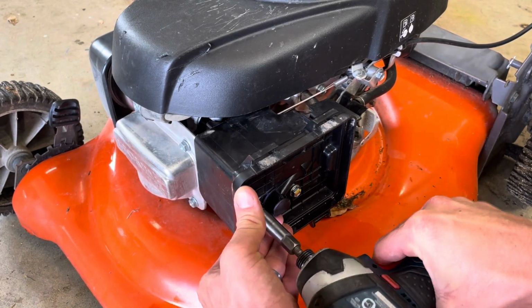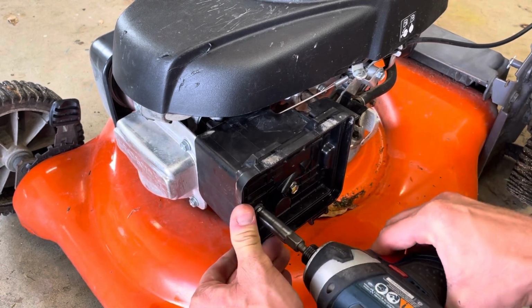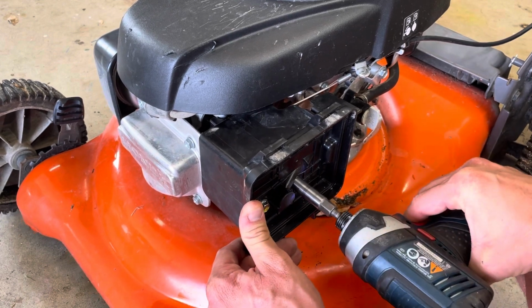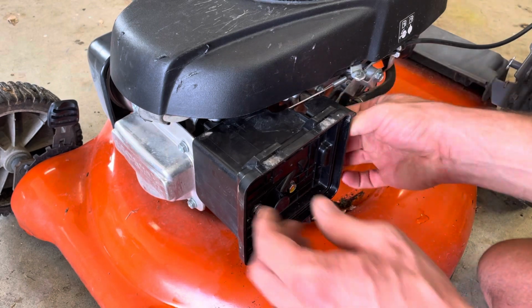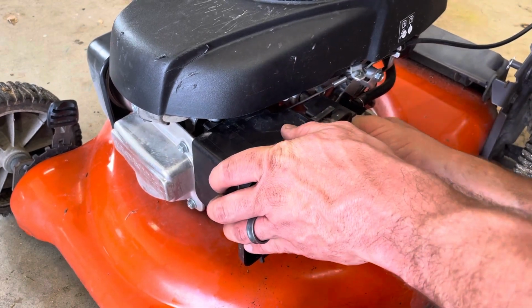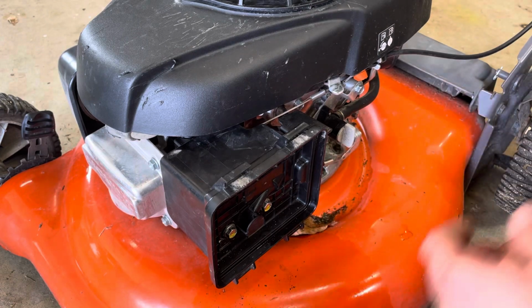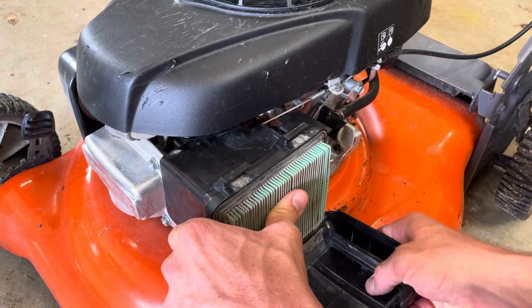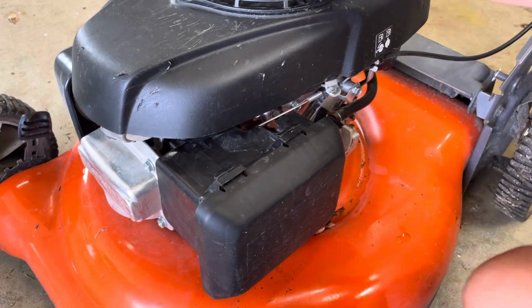Then do a little on one side, a little on the other. So you get things lined up properly, nothing cross-threaded, nothing on an angle. And then you can reach in behind like this and plug in that last hose. There's plenty of space to do that. You turn on your fuel valve, reinstall your air filter and your cover, and you're off to the races in 6 minutes.